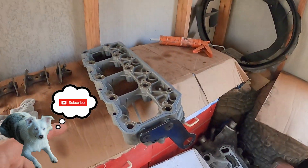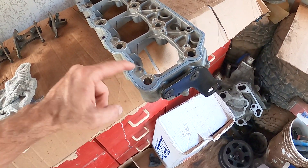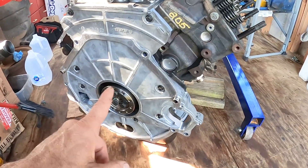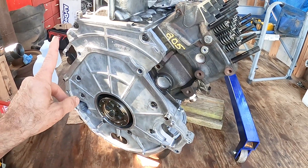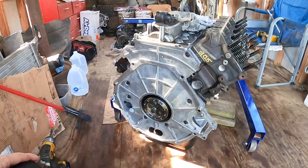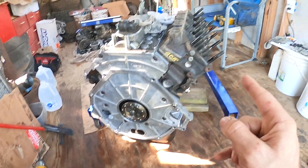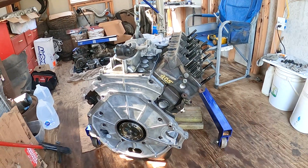Welcome back to the series. I got online last night and read horror story after horror story of people getting their engines rebuilt by either Ford or some shop, and a couple weeks later their engine is leaking oil like a stuck pig. What I did — and what some people recommended — was use that T31 on my rocker box mating surface. I also this morning pulled the rear cover back off and put a bead of T31 RTV around that O-ring as well, just like the rocker box. Now I'm going to get the rocker box back on the engine stand, get the rocker box on, start putting that head together.